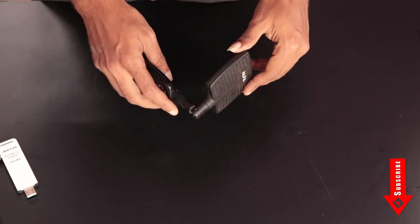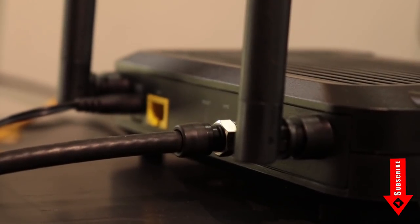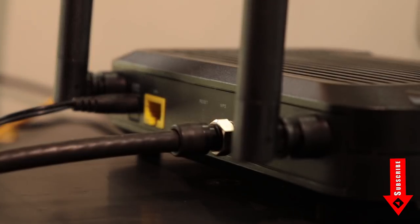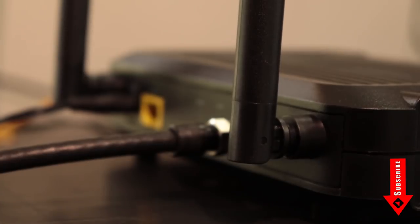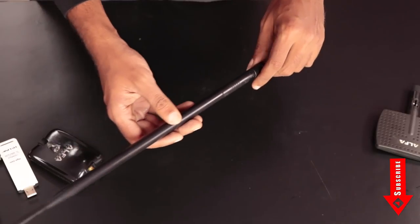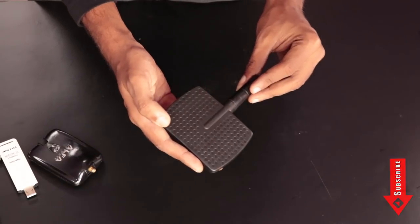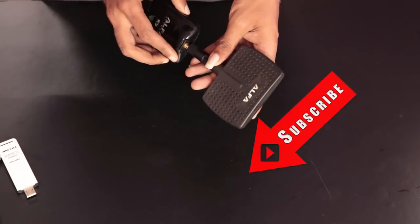You can increase the Wi-Fi speed and range of your Wi-Fi router using an external antenna. Usually, the Wi-Fi router antennas provided by manufacturers have 2 dBi or 3 dBi power gain, which is very low compared to the currently available antennas on the market. Some Wi-Fi routers allow you to change the stock antenna. So if you have a router that supports removable antennas, you can get a higher gain antenna like a 5 dBi or 7 dBi that will significantly increase Wi-Fi range. In the next video, I will show you the latest hacks to increase Wi-Fi range and get high-speed network connectivity.